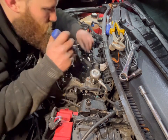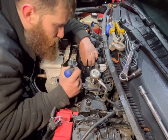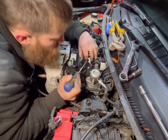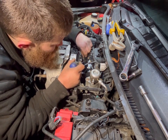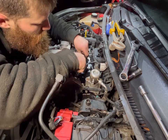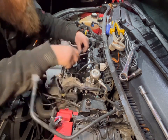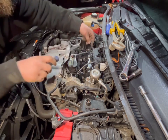So that's them. Next, what you need to do is down where the injectors are, there's the injector plugs. So just get a decent pick down to the injector plug, and then you need to pop the clip in so you can remove the plug like so, and do that for all three. Again, because I'm not the tallest of people and the car's lifted up already, it doesn't make it the easiest for dwarfs like me. There we go. So that's all three of them.